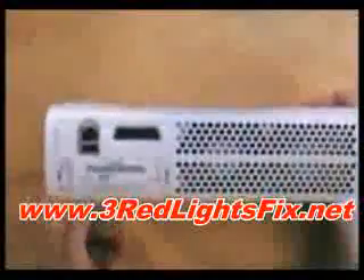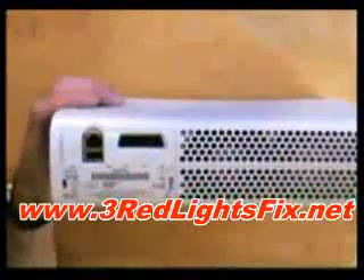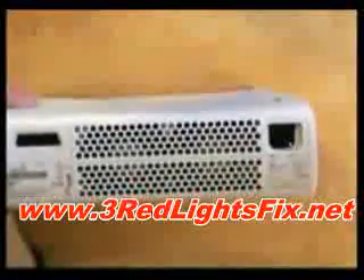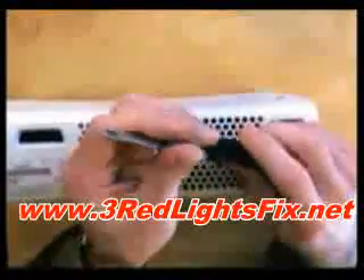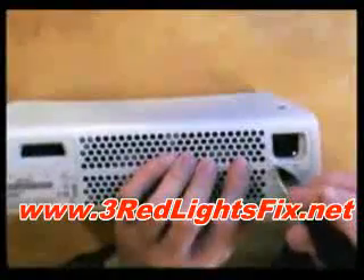You've now got your four clips here — these ones are very easy to do — but the ones at the back are the fun ones. To take the case off you're going to have to push in all the clips on the back: there are five here and two here. You can either use a small flat head screwdriver, or I tend to use one of these — a little knife. It looks wickedly sharp but I can promise you it's very, very blunt, and because it's so thin it doesn't leave any marks at all and it's also quite easy to push in.